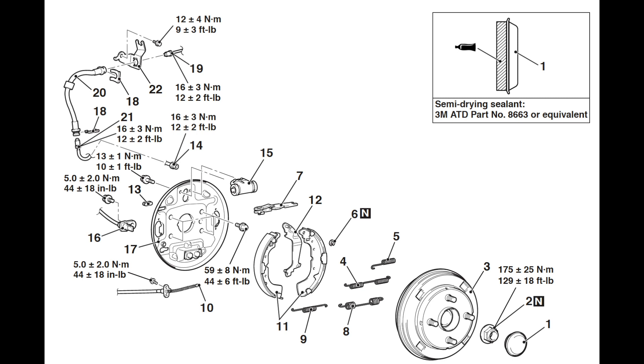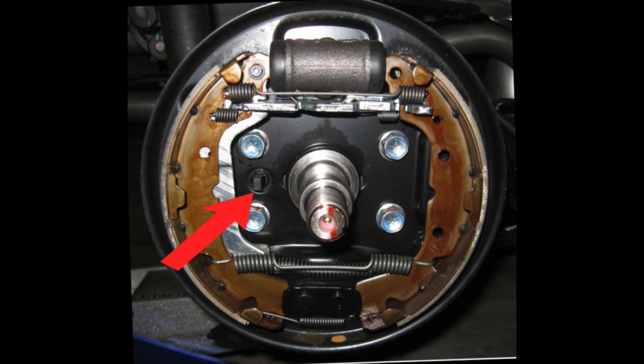Here is a diagram of the rear brakes — do not worry if it does not yet make sense to you; it hopefully will by the end of the video, and feel free to leave a comment below if not. Shown here is the wheel speed sensor. It is a Hall effect sensor that detects the magnetic field from the wheel speed encoding ring mounted on the drum and sends that signal to the computer to allow it to calculate the speed at which this wheel is rotating.